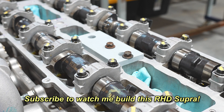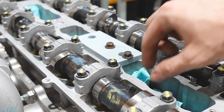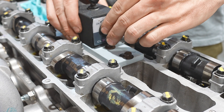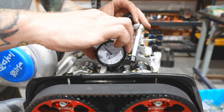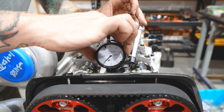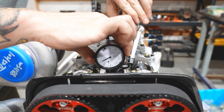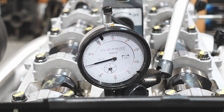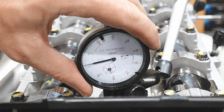We're going to set the dial indicator on a mounting plate because the magnetic base won't magnetize to aluminum heads on this 2JZ or any other engine. This will vary depending on the engine you're working on, and oftentimes you will need an extended dial indicator rod if the spark plug hole is deep in the cylinder head, like it's going to be on most inline four or inline six engines. I have a link for those in the description.